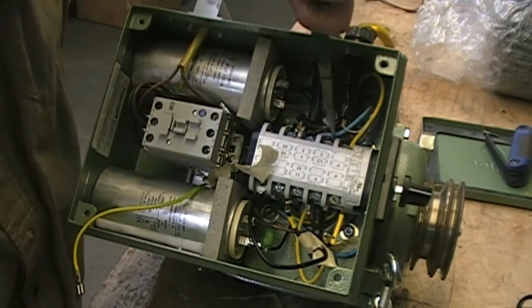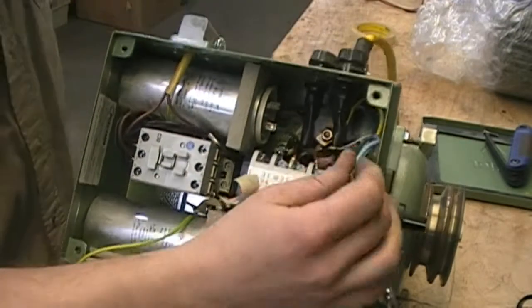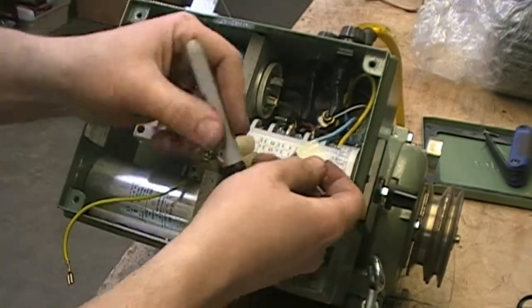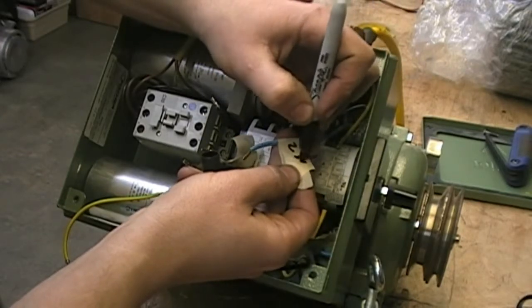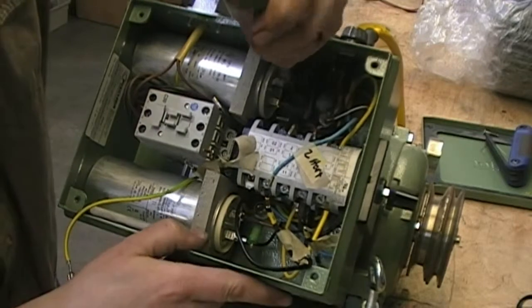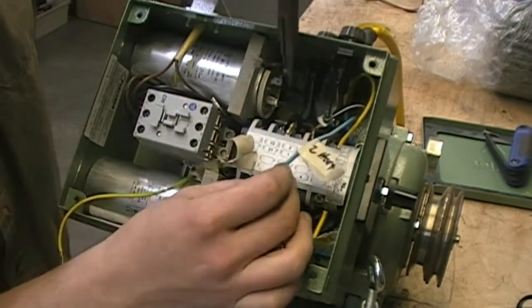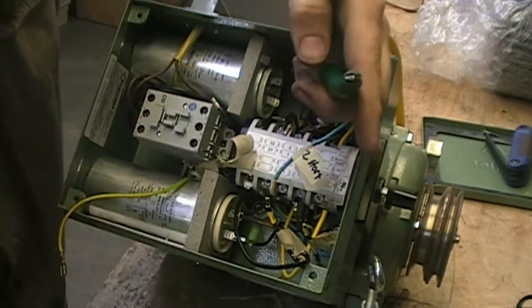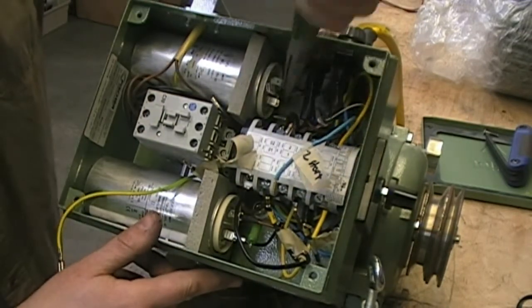Also connected on the number two is this blue wire. This blue wire is actually a start wire. We want to label it as two because later on it will be connected with that number two. The other start wire is connected to the run capacitor over here. We can easily identify it because it's the same color as the other start wire — typically they'll both be the same color. There will be a wire on the other side of the run capacitor that feeds over to the switch, and this wire feeds over to the other capacitor. So you'll have three wires total — you just have to determine which one goes into the motor. That's your start wire.